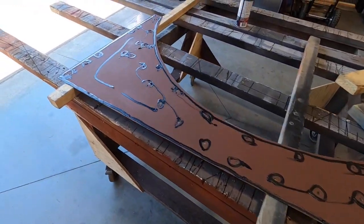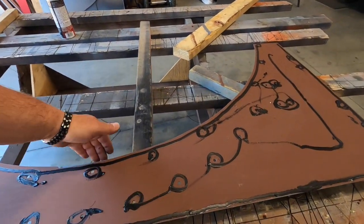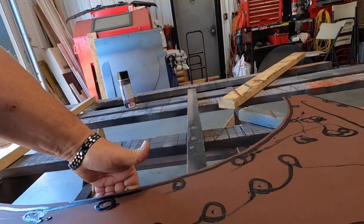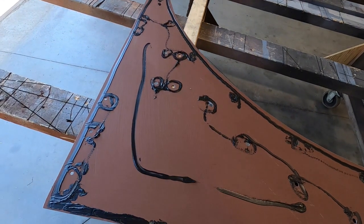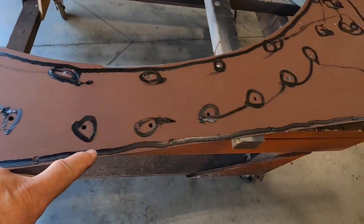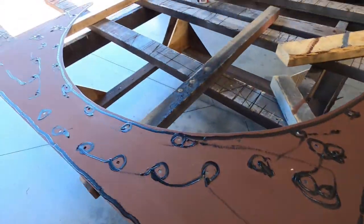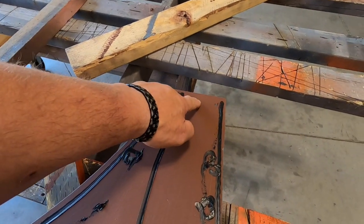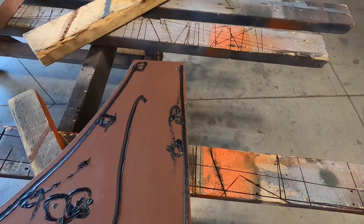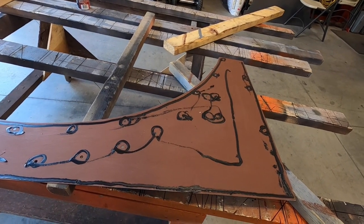There's the panel — the inside has two layers of primer on it, and the outside has three layers of primer. This is the sealant pattern I'm using — just some seam sealer. The top edge needs to have enough on there so water can't run in. The back and front have sealant on, but the bottom does not so that if water gets in it can run out the bottom. These aren't going to last forever, but they're just as good as what was on the bus.